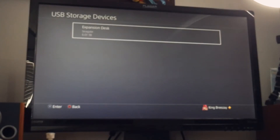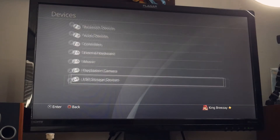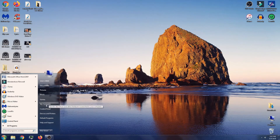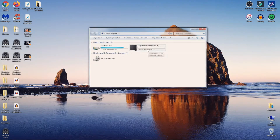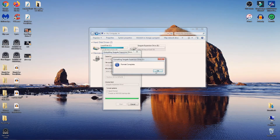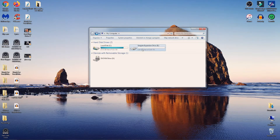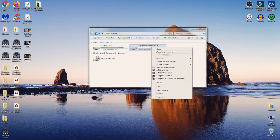So now I'm going to disconnect it from my PS4. This is where you need a laptop or a computer. I already plugged in my hard drive, then I'm going to go to My Computer from Start. You'll see the hard drive is right there. You don't have to double-click it — you've got to right-click and then go to Format. Click Format, then Start, and let it do its thing. It might take a while, so at this time you can go grab yourself a beverage, go to the bathroom, grab a snack, take a nap. Then when it's finished, go ahead and click OK, then click Cancel. After cancel, you can just unplug it. That's it.